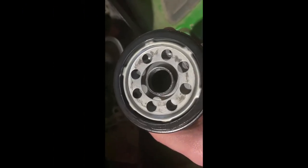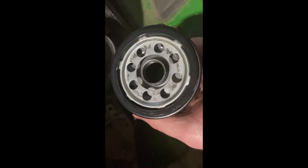For the oil filter — this is the filter number right here, this is what it looks like brand new. What you want to do is wipe all that old oil out of there. However, you don't want to put the oil filter on with a dry gasket — you actually want to dampen it with a little bit of oil. After you put a little oil on there it should look like it's got a glaze to it. Then you can just twist it on. I hand-tighten it as much as I can, then take a towel and get just a little bit more. The gasket is what seals it — it doesn't need to be cranked down, but you don't want it loose either.